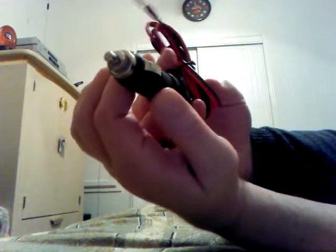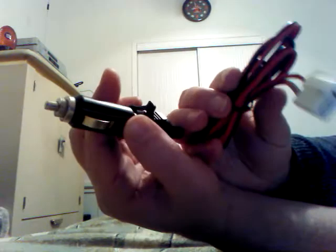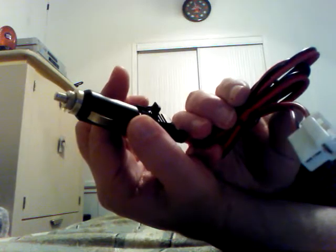And this little ring, I added this to it. But anyway, it's got a 15 amp glass fuse in the tip here. And the wire seems pretty good thickness on here. I think it's just a gauge smaller than what the factory is, or it's close to it. But it's only 7 foot, and the radio only draws, I don't think, any more from the factory. I think it says 8.9 amps, so this is more than enough.